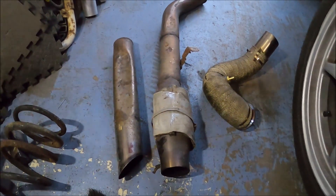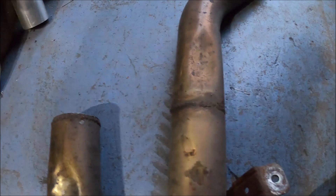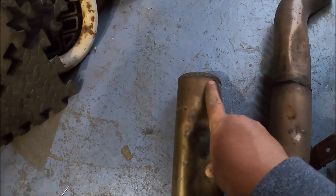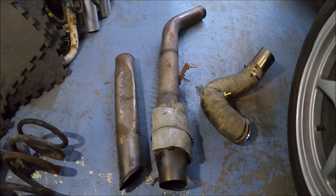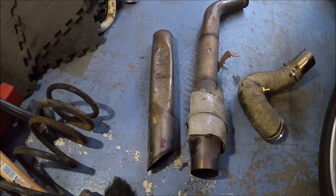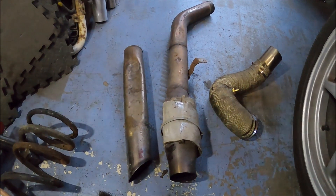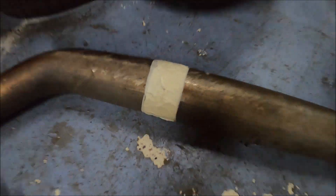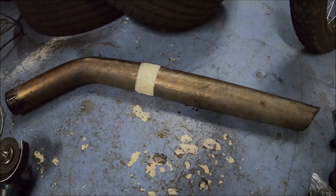What I did originally — I didn't know if it'd work well — I cut it at some welds. This is the original section, I cut it there and quickly welded it back up. There's the original weld, so I'm hoping I can literally cut that off and it'll be the right length to whack back on. I want to weld a lambda bung on it just in case I want to try that again. Time to make an exhaust. A minute to cut it and a little bit of tape temporarily, and that's going to be the new tailpipe section.